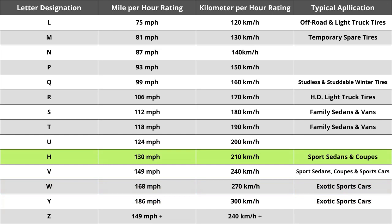While speed rating is important in some unique cases, you shouldn't spend a ton of time comparing tires solely based on this. You do want to make sure the tire matches your vehicle manufacturer's specified speed rating. In almost all cases, the speed rating should always be above 85 miles per hour, which is technically the fastest posted speed limit anywhere in the United States. Make sure your current numbers and letters all match to ensure a seamless buying experience.